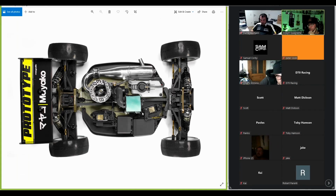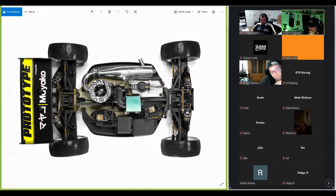One thing that people always are sort of fixated on somehow is that the servo arm should be somehow perpendicular to the servo itself or something like that. That's completely irrelevant. That doesn't change anything. What is relevant is the angle of the servo arm in relation to the bell crank here and this arm. Depending on the design, it might be at a weird angle like this, for example. It looks like, okay, the wheels are straight, but this is not perpendicular to anything. It looks wrong, right? But it's not a relevant angle to think about.